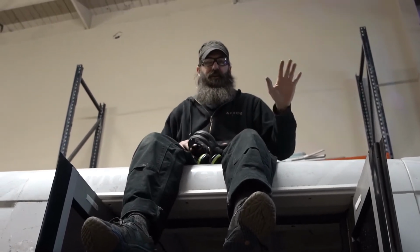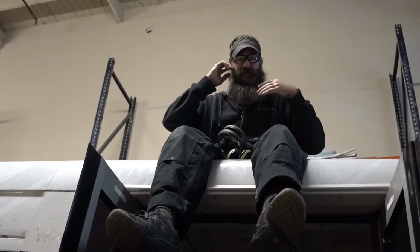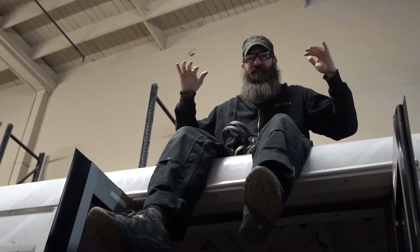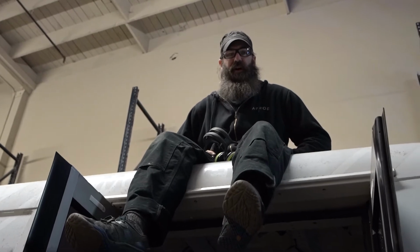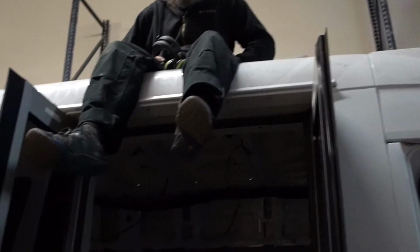I have conflicting opinions. I have a friend who builds hot rods, who I trust a lot, who says to weld in a bunch of extra bracing, because if the body pops out of shape, it's impossible to get back into shape. And then I talked to a van company who puts pop tops on vans. They're like, nah, we just cut everything out all at once and then put our top on and it's fine. They're like, the vans are super strong and it's cool.